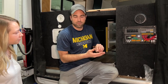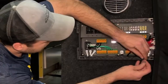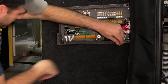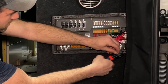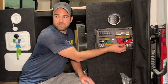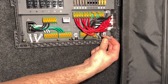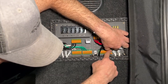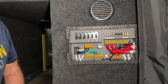You need wire ferrules, which just slide on the end of the wire, like so. You got a special ferrule crimper. Slide it to the end, crimp. The crimp leaves behind a special mark on there so you can see that it actually crimped. The negatives will get dropped onto this bar here. And once you have the ferrule seated, you just close the lever and that wire's terminated.